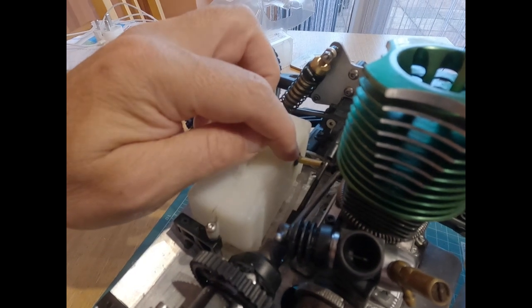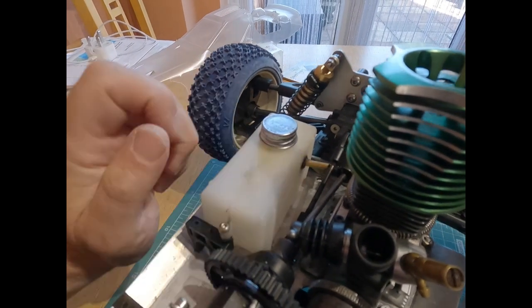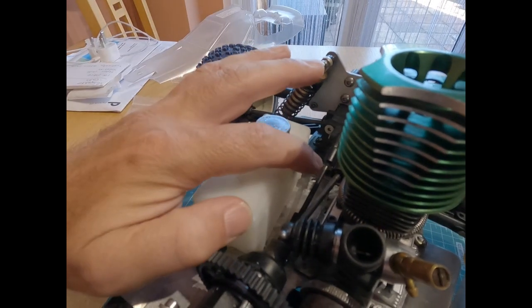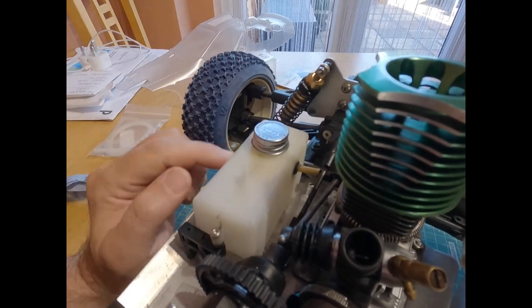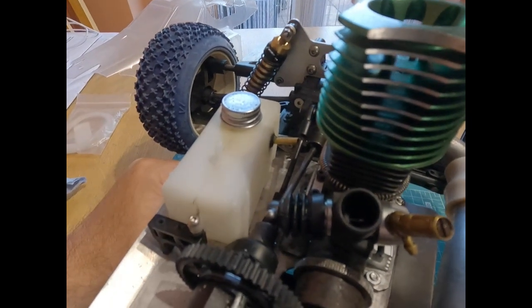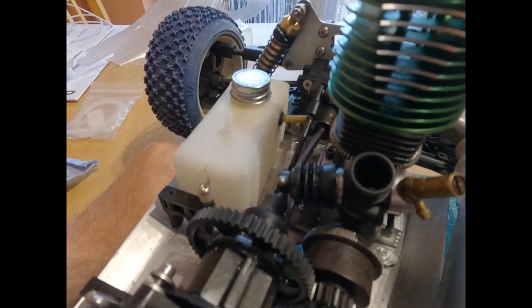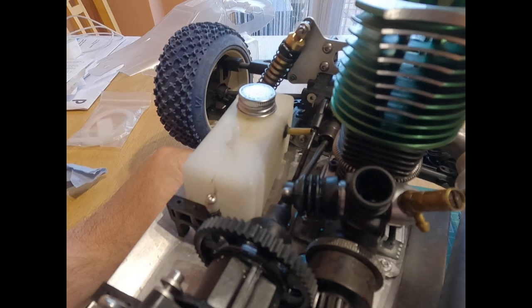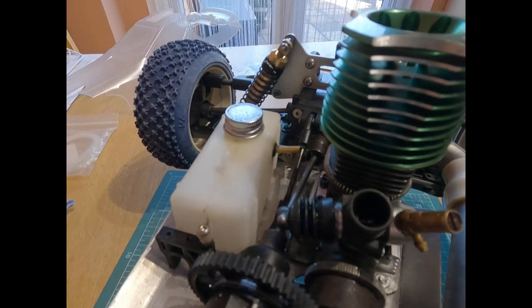I purchased another fuel tank only because it had some grommets - it was from a Kyosho. The grommets that came with it perhaps weren't the same size. However, I put a piece of brass pipe in there with a bend in it so it goes down to the bottom of the fuel tank. But it is at an angle, which clearly means the bottom isn't going to seal properly. I can put some more sealer in it to try it out, but clearly it needs to be straight. That was what the recommendation was - with a 45-degree bend in the pipe.